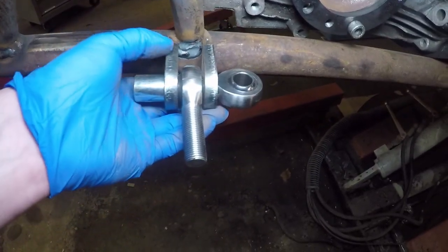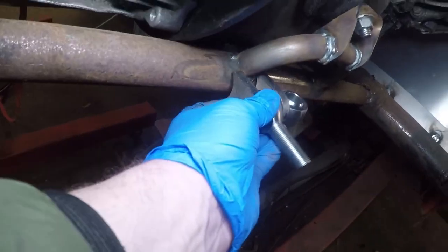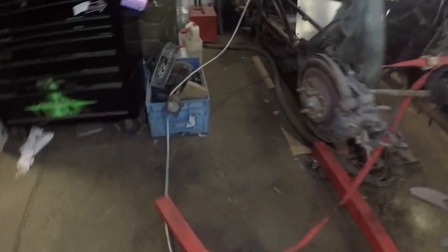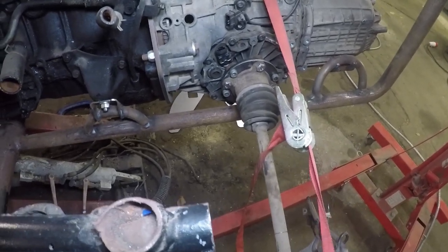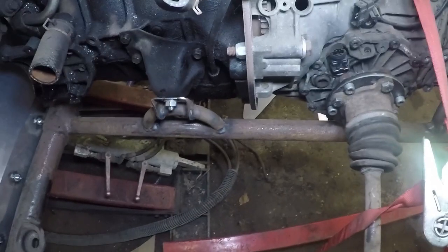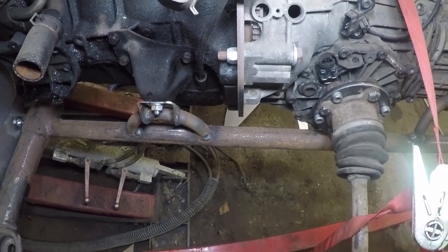But even flat doesn't fit, so I'm going to have to notch the top of the brackets out on this side and the same on the other side — they don't fit flush to the tube at that angle. I've basically just created a lot more work for myself by not thinking it through, but hey, that's half the fun. I'm going to have a play on this side first — it's the easier side — and try to shape the brackets and see if we can get an arm tacked on.